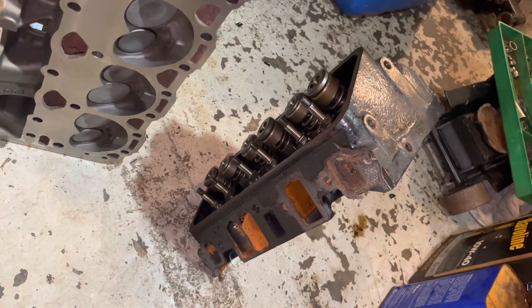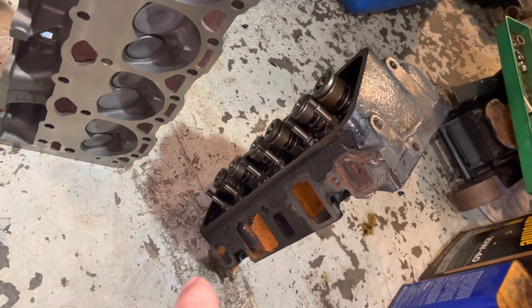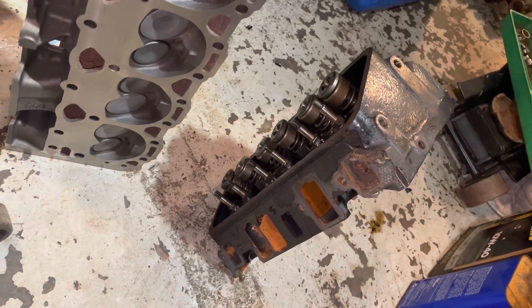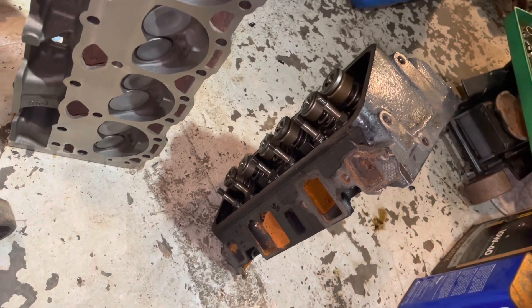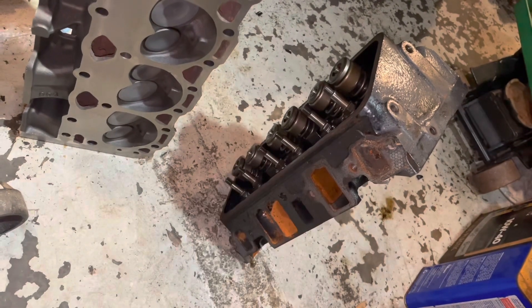So that's the discussion about the heads. Be warned that if you want to use a car or truck engine, you want to get a 1996 and later Vortec engine. I don't know why you'd build it with any other type of head. You're going to have to source a Vortec intake if you have the old-style heads. Now, if you have a V6 and it already has the Vortec heads, you're ahead of the game — you've already got the right intake, so you just bolt it on.